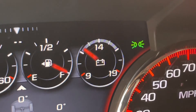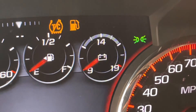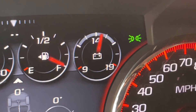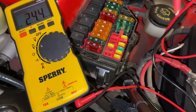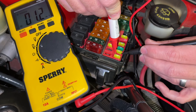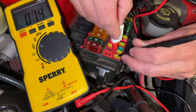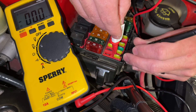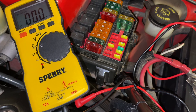If you do have a voltmeter, you'll notice as you start the car it'll go from 12 volts up to 13.5 to 14.5 or so — that's a good way to monitor whether your alternator's working. Hopefully this gave you a good idea of how to test your battery and how to know if your alternator is actually working: the difference is 12.5 volts at rest versus 13.5 to 14.5 volts with the car running. Thanks for watching — check the video description and we'll catch you on the next video.